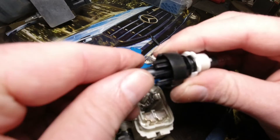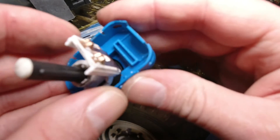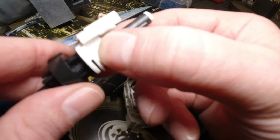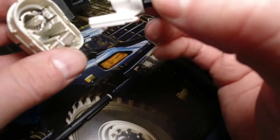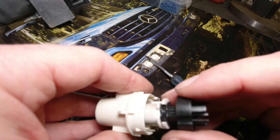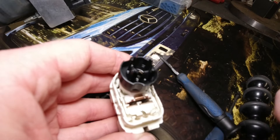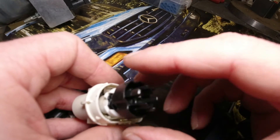The purpose behind something like this is clearly the improvement of the installation. Here are the contact plungers - they should be clean and in good condition of course. I will have to replace that switch after me messing with it - I don't want to have it in the car anymore. Let's take a look at this contact piece and how it actually travels up and down in the switch. You can see there is a gap in one of the contacts - one of the conductors is interrupted - and in the home position I think that switch is actually in the interrupted position. You wonder why somebody would design something that complicated - making contact, then no contact, and then contact again.